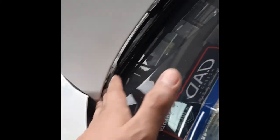So I was worried that it will induce thermal stress on the glass and it will crack the glass. So I tried to angle, cut off this bracket a bit and angle it. As you can see, there's some angle over here to direct the air this way, but it's still not enough. Still, there was some hot air coming this way and heating up the glass. So actually, after I angled it this way, I noticed that the hot air isn't really coming from here, not that much from here, because it's not this area that's being heated up, it's this area.